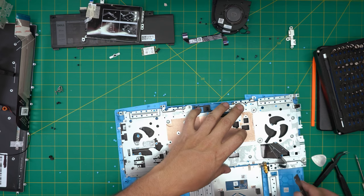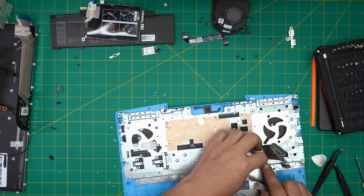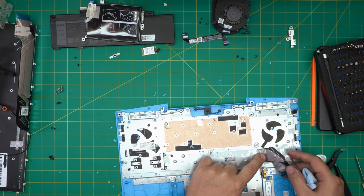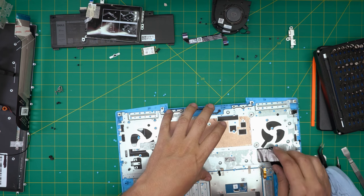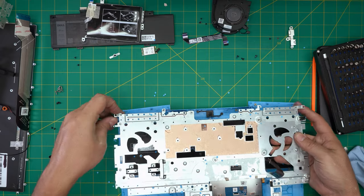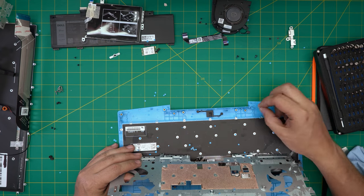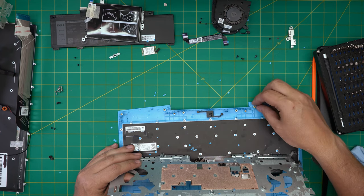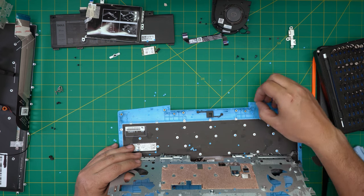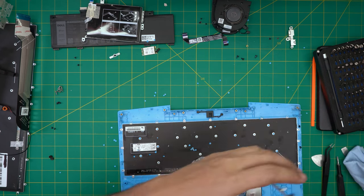Now that we've finished the first round, I need to identify where the flex cable for the backlight comes through — it goes right through here and up. That's important to note. Lift up this one and you can see the riser is broken — you can fix that with super glue or epoxy. Put this shield to one side and clean up the workspace a little.